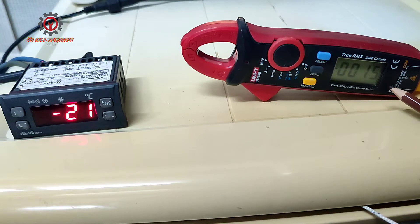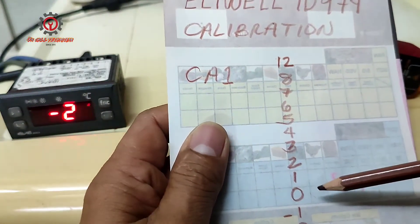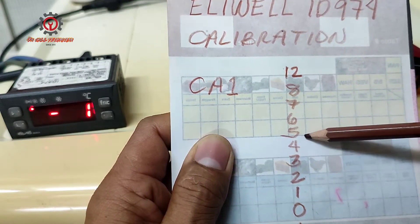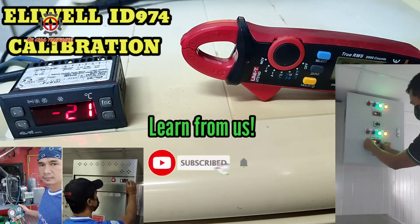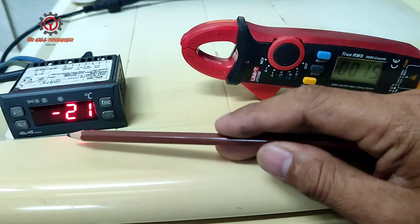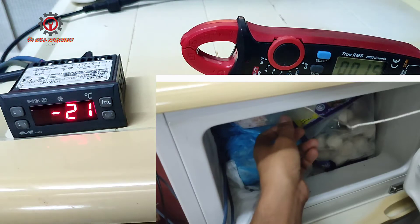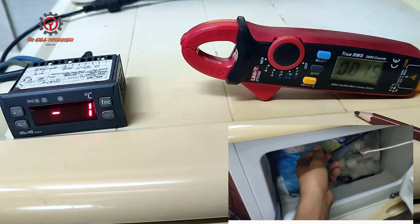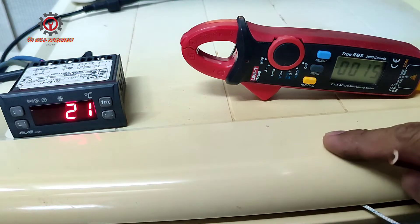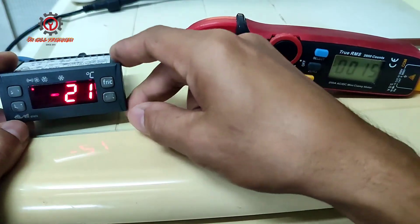In this case I'm going to correct this control to match the proper temperature. I have a differential of six, so I'm going to change the value from zero to six. The negative 15 is the proper temperature — that's the reading inside the refrigerator. The negative 21 came from inserting the sensor near the evaporator, which is why that reading is lower.